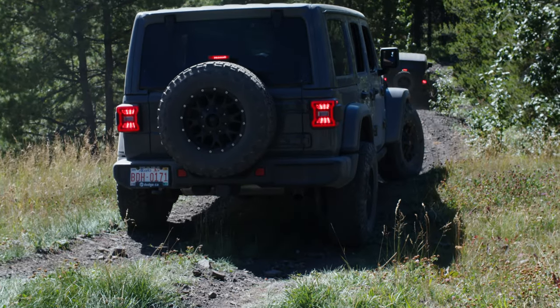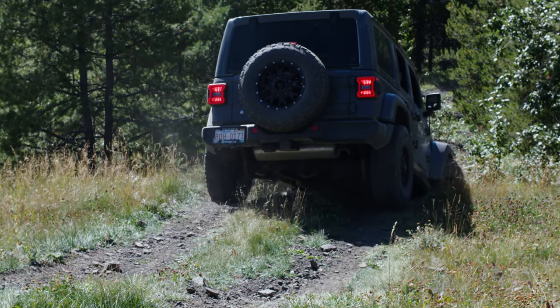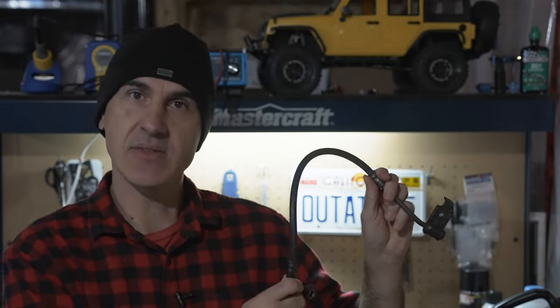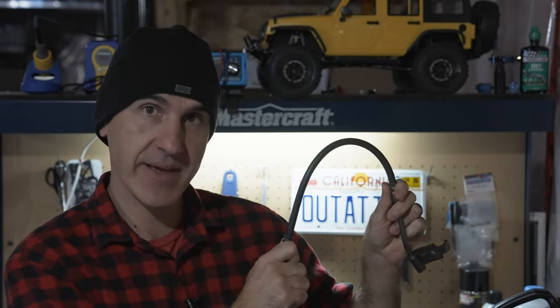There are a couple things wrong with doing what amounts to about four kilometers of descending and using your brakes to control your speed versus your engine. Even if you're going slow, your brake system is going to get really freaking hot. These rubber hoses already expand under hard braking, so as the temperature increases that problem compounds — more expansion at the hose level means less fluid into your caliper. There's a common term for that: it's called brake fade.